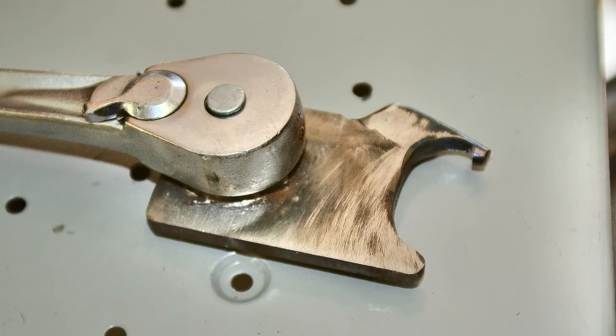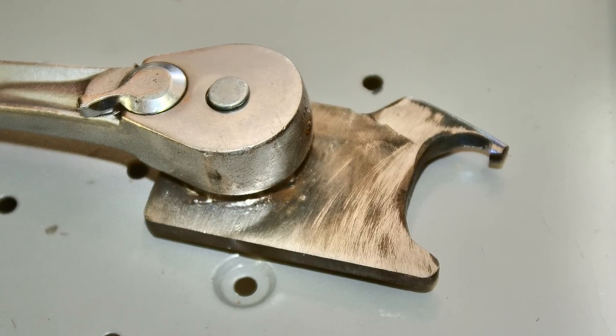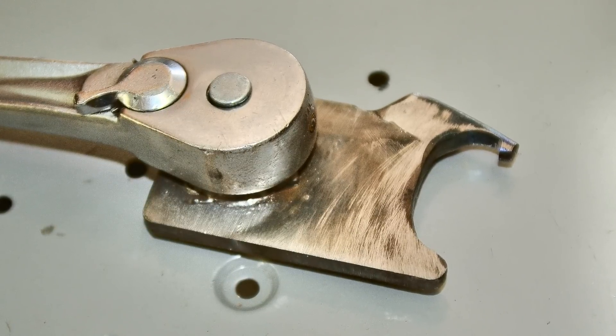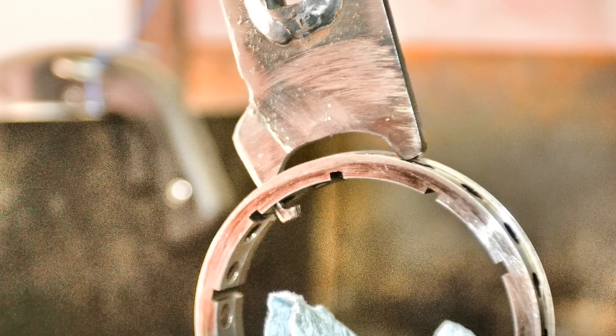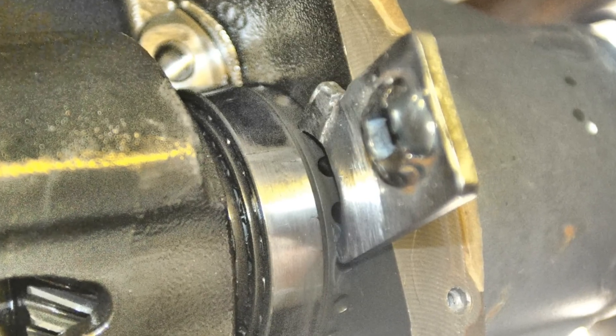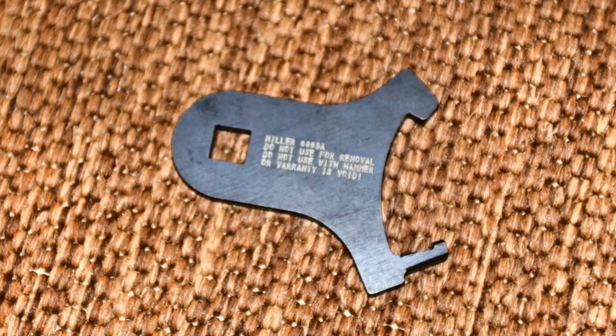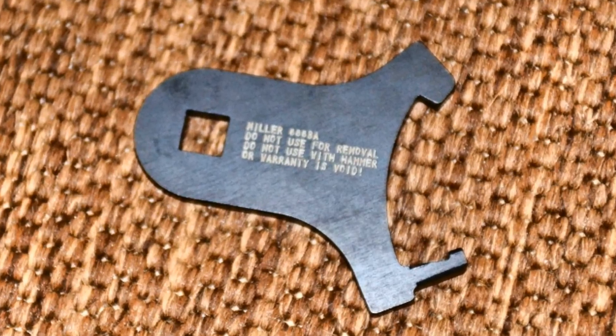Welding and surface grinding have eliminated any trace of the original bolt and plate as separate pieces — metal fusion was complete. The new tool fits the adjuster ring, its hook grabbing the slot hole much like the factory tool. The tool was tested on the 11½ inch ring and pinion gear set installation. Avoid bending or shearing off the hook arm on either design.